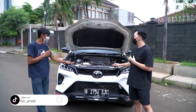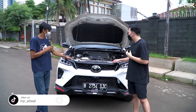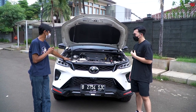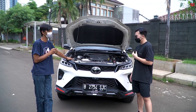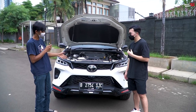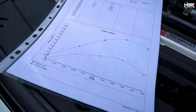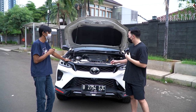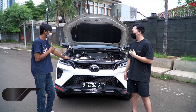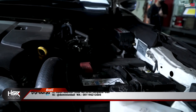So what else can I modify to get more power? For diesel it's easier than a gasoline engine. You can upgrade to a bigger turbo — and then a bigger intercooler to match — and then remap again to match the turbo's performance. From the current 203 HP, that could bring it up to around 280 HP.